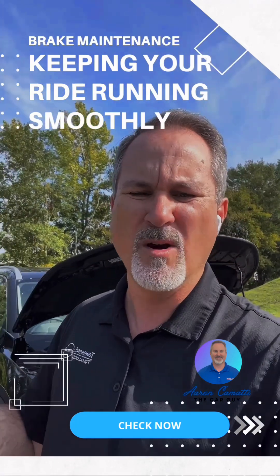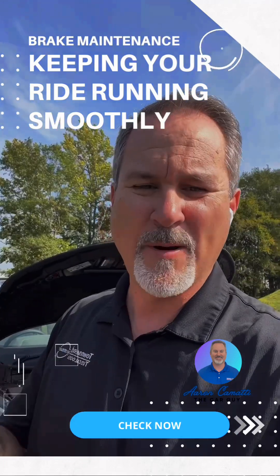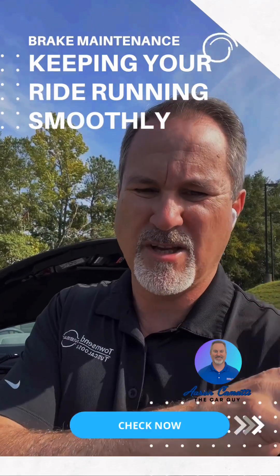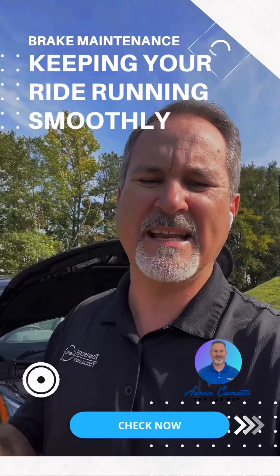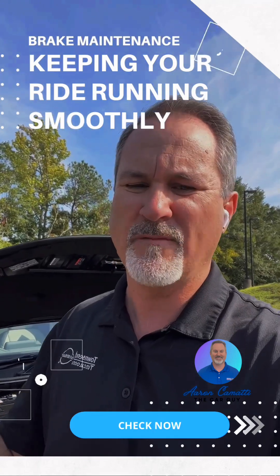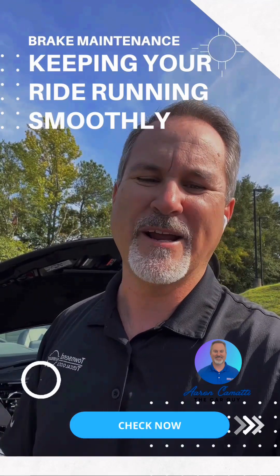Just put the right amount of brake fluid in the master cylinder. Make sure you check with an auto parts store or your manufacturer's shop to get the right brake fluid. Also, don't use anything that's been laying around the house for a long time, because brake fluid draws moisture real easily. If it's already been open or sitting a long time, toss that and get some new brake fluid.